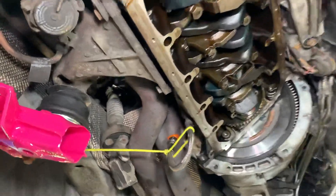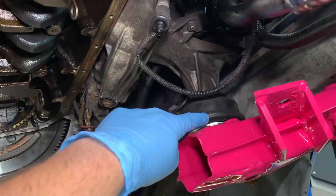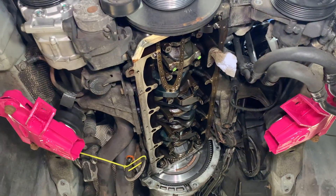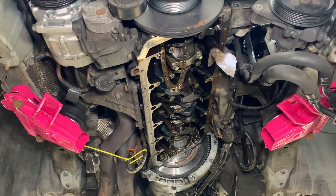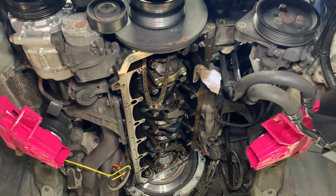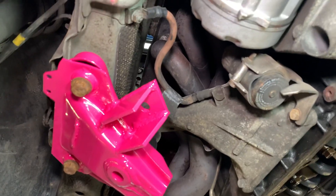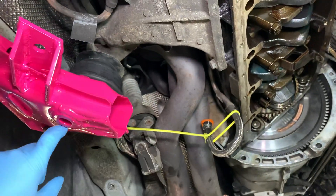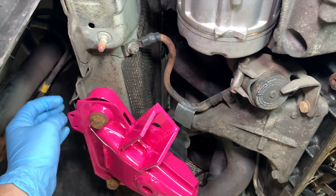We've also changed the engine mounts — you've got new engine mounts, one for the right-hand side and one for the left-hand side of the engine. You're also going for a few other things: you're having a powder-coated new front subframe, which makes sense since that area is already off. We'll disassemble the steering rack from the old subframe and transfer it onto your new powder-coated subframe with new subframe bolts, as your old ones are corroded. We'll also fit new nuts for the engine mounts, new nuts for the wishbones, and a new potentiometer system for the xenon headlight levelling system.